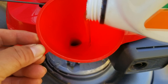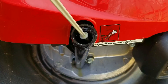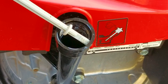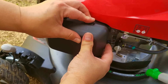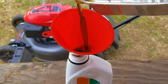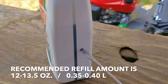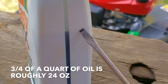The last step is the most important one, and this is where they made their mistake. According to the owner's manual, this particular engine only takes 12 to 13 and a half ounces of oil, which is a surprisingly low amount. The older engines seem to take around 18 to 21 ounces, so this is quite a change. I would assume the engine's oiling system has also changed to work with a lot less oil as well. You could just pour the exact amount of oil into the engine, but I would always check it using the dipstick to make sure you didn't overfill it. The dipstick is really tough to read, especially with clean oil, but it looks like it's at the full mark. Before I start it, I want to see how much oil was in the engine — I'll pour the old oil back into the empty bottle. It looks like we drained about three quarters of a quart, which is around 24 ounces — definitely too much oil for this engine.